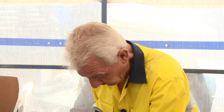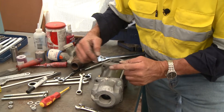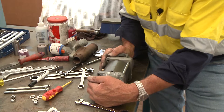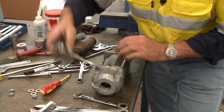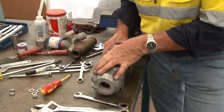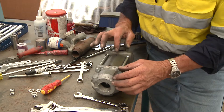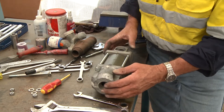Align your marks. You're going to fight the spring — the spring behind the piston is the thing you're fighting. Just get your bolts started in there and you'll find that once you get them started, it'll come together and just squash up. Ensure that it's all in place in situ.